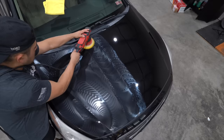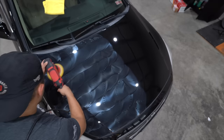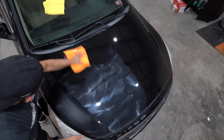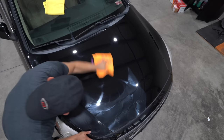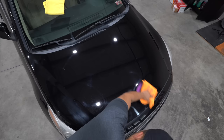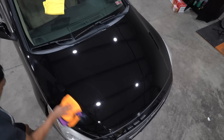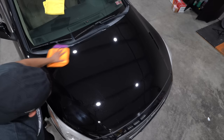There were some areas where I did a second pass with the cutting disc or polishing pad that I didn't show on camera. But even with that, it's still faster to work larger sections and do some touch-ups here and there versus doing a little two-by-four section across the entire panel. Another factor to consider is how hard or soft the clear coat is — if the clear coat is very hard, working a larger section may not allow you to cut and actually remove the swirls and scratches. In that case, working a smaller section is more optimal.